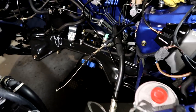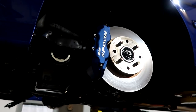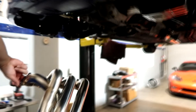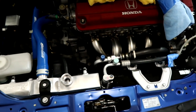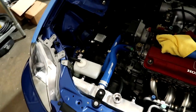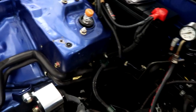I'm waiting on George doing the harness, so I figured why not make that look a little prettier. Motor is in, all the mounts are tight, axles are on - now it's time to put the header on. If you've done these before you know it's a one-piece header that goes from the bottom. I'll be intrigued to see how close it sits to the pan. The header fits really nice - we're going to wipe that down before we start the engine. Radiator's in, Spoon hoses are in. I'm going to save all the brackets and bag them so he can take these back.